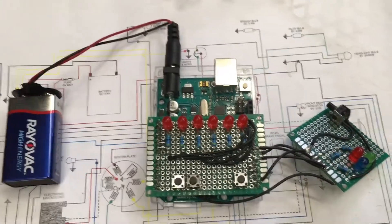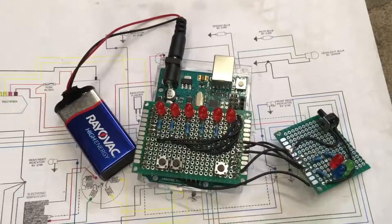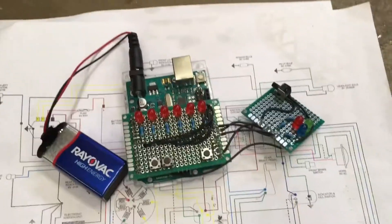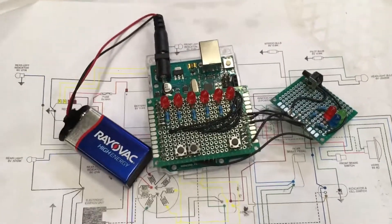This high beam indicator right here — I'm going to put in an RGB LED so it can show me things: it'll blink red for turn signal, turn on blue when the high beam is on, and I can basically program any functionality I want into it. If I wanted to have it flash like a disco strobe when I start it up, I can do that too. I'm teaching myself how to program, so just add that to my list of hobbies. We've got a good 7 volts coming off the buck converter and this will run on a wide range of voltages including 7. That would also charge a small SLA battery that might be useful for when I'm at idle.